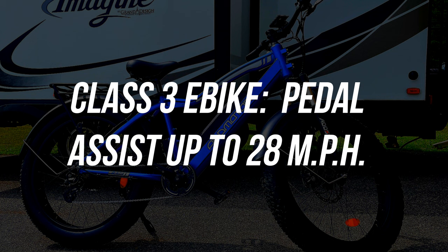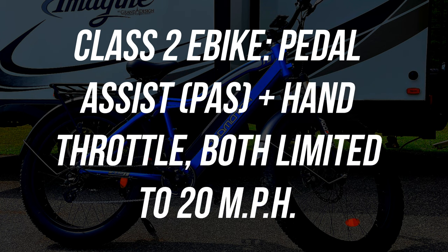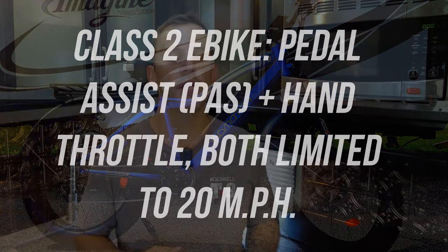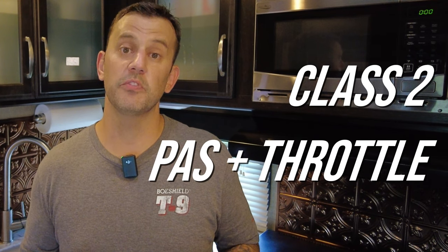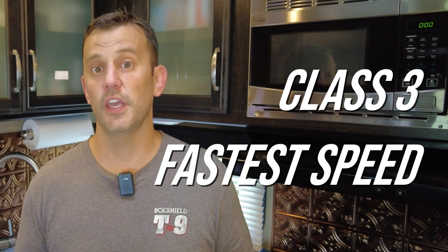It's a very strange feeling the first time you ride a pedal-assisted bike, but very cool nonetheless. Class 3 is also a pedal-assisted bike, but instead it will go up to 28 miles per hour, and you still need to pedal to activate the motor. Then there's Class 2. The difference with Class 2 is you have a hand throttle control that will propel the bike without pedaling. The hand throttle, though, is legally limited in the United States to 20 miles per hour. In my opinion, and from all the research I've done, Class 2 seems to be the go-to — having that hand throttle is really a fun feature. If you want to go as fast as you possibly can, you probably want to look at a Class 3 bike, because that will take you up to 28 miles per hour on pedal-assisted, but remember, no hand throttle.